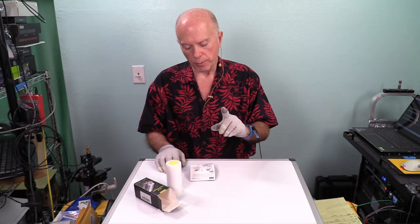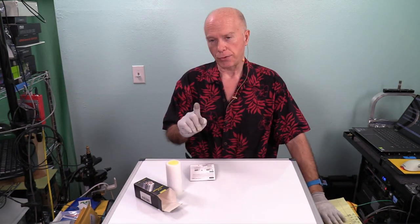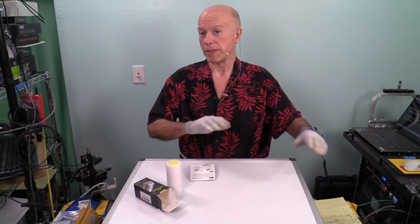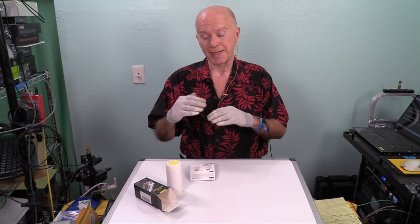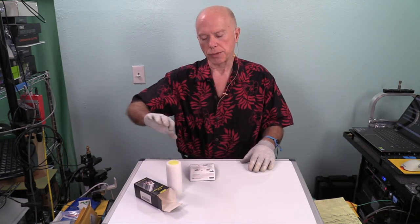Now for the numbers. The numbers we're looking at, and I have to read this. Our hottest without a heat sink was 92 degrees, and our best temperature with the other heat sink that had cooling pipes, that was 54 degrees. That was phenomenal. I was really impressed with that. But remember, if I remember correctly, we had three pads on that. It was designed that way because of the way there was a lip that I'll get into more in the summation. Just remember there were three pads on that particular one.